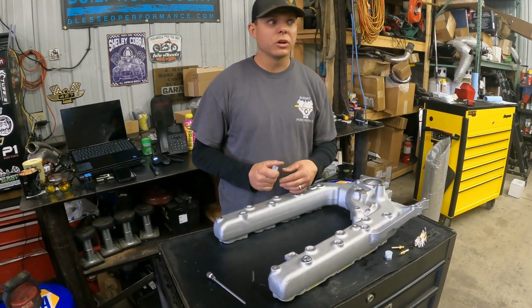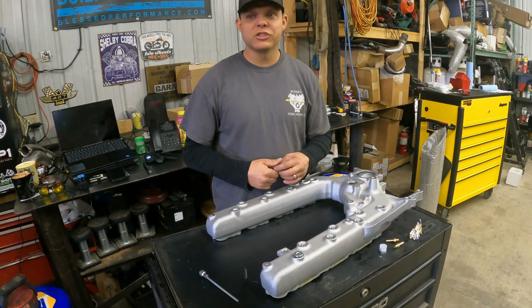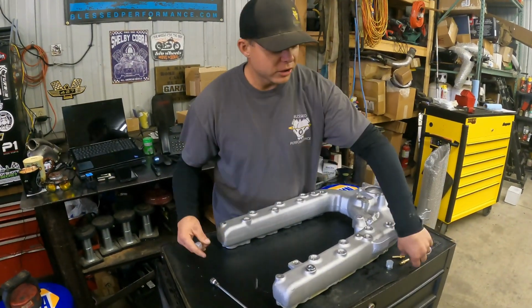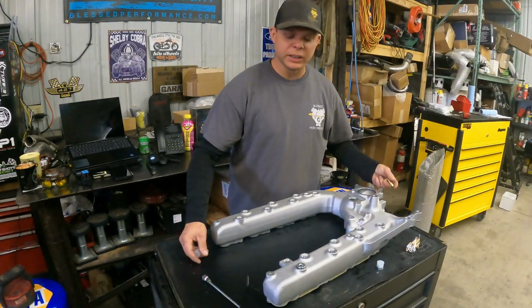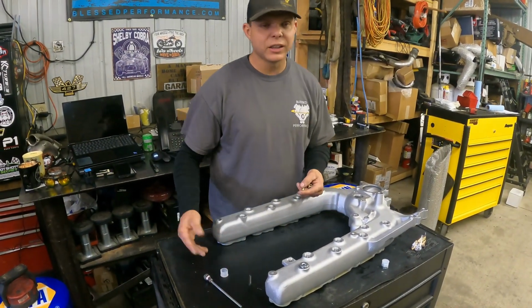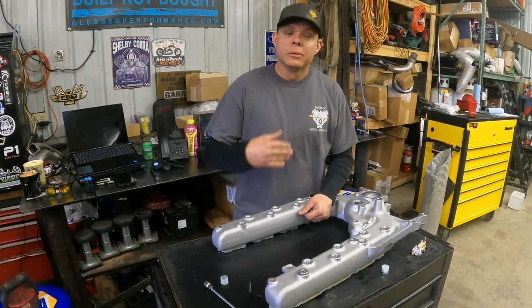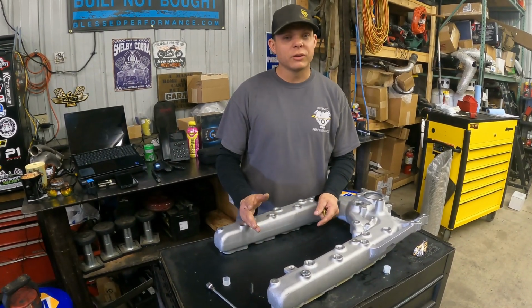Of course, I'm sure that's more on a highly tuned, big injector, big turbo truck, but on this truck, or on a stock truck, that's what you see. Also, you see about a 150-degree drop in EGTs. In general, some trucks see 350, some see 150. We call it 150 to be safe, but I can tell you from experience, most trucks are right about 250.